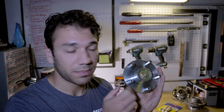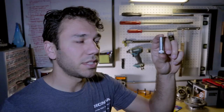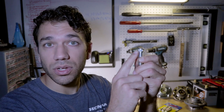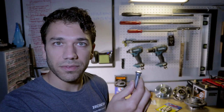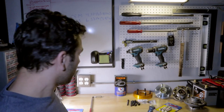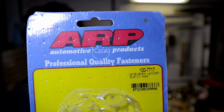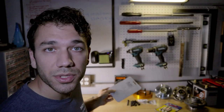Now, the second thing that is different about these compared to OEM is the wheel studs. These are basically the same thread pitch and size as stock. However, the base here is different, and I wanted to install extended wheel studs. So I decided to go ahead and measure these and figure out what size they were. After measuring them, I was able to find out that you can find extended studs from ARP from an Evo 8. There's the part number for you. I'll also put a link in the description down below.